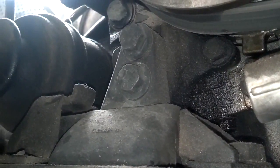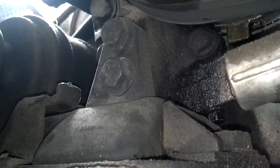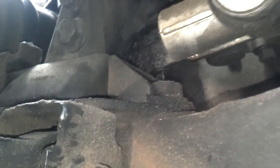I'm going to try to go in here and videotape this motor mount to see if it needs replaced. I didn't have the luxury to have the car on jacks. And actually, that mount is standing nice and tall and high, so I do not need to replace that mount. Normally, if that lower bolt is down against the rubber, the mount is blown out — but this one is evidently good.